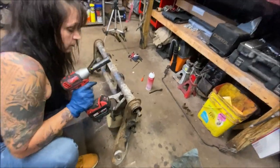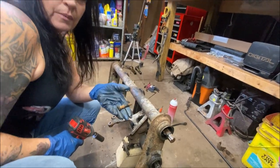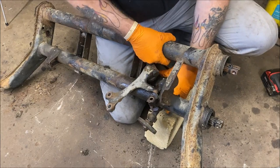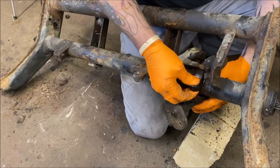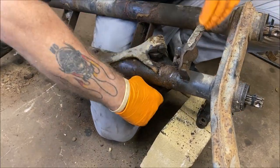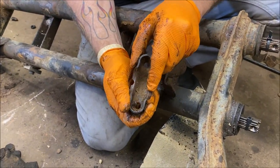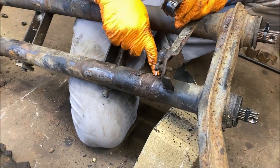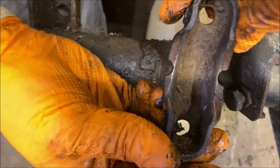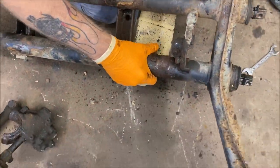Heather has her 17 millimeter impact. Let's see if it'll take it off. Good, it came out. Now we're going to go ahead and pull the steering box. The bolts are loose. As you can see, the steering box is literally falling off now. There's the steering box. Do you see these tabs here? If you look here on the beam, you'll see a notch there and a notch there — that's how you know it's lined back up when you put that steering box on.